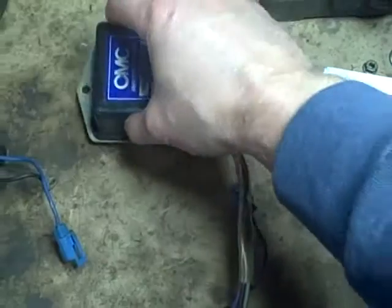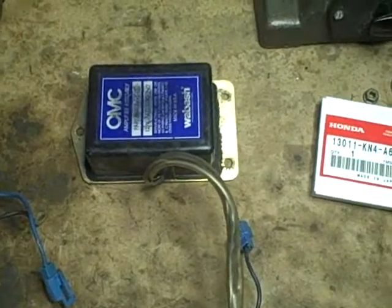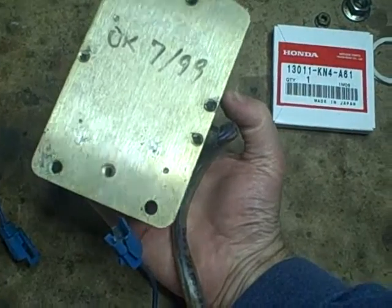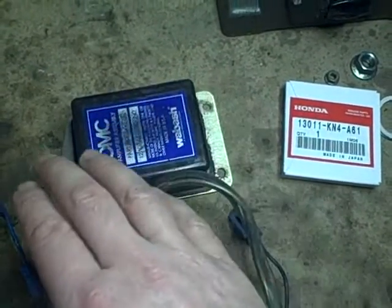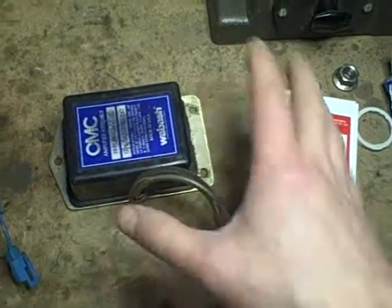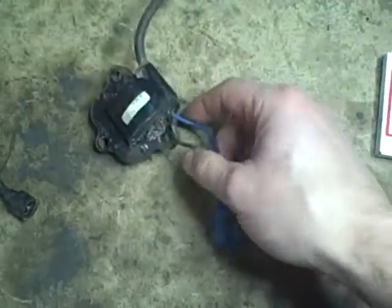This one looks like it was marked July of 99 as being okay. I wonder if it was already a replacement because I know that outboard is actually from 1969 or 1970. If this module ends up testing bad, we're going to open it up to see what's inside. Chances are the electronics are going to be encased in some sort of potting material designed to keep out moisture and isolate the unit from failure due to vibration. But if it's bad anyway, what's the harm in tearing it open?